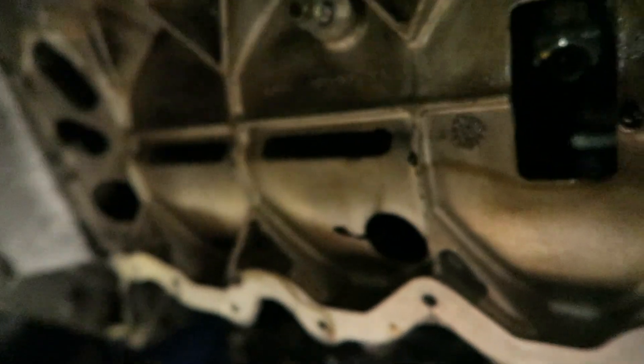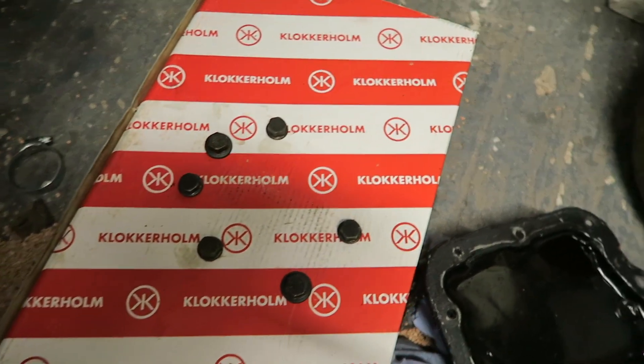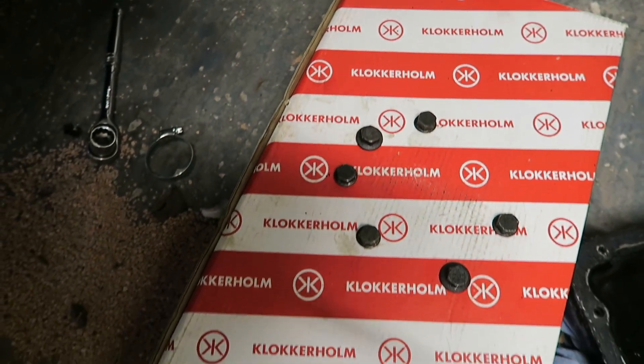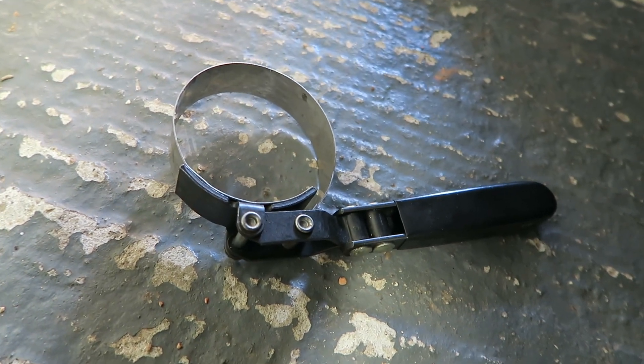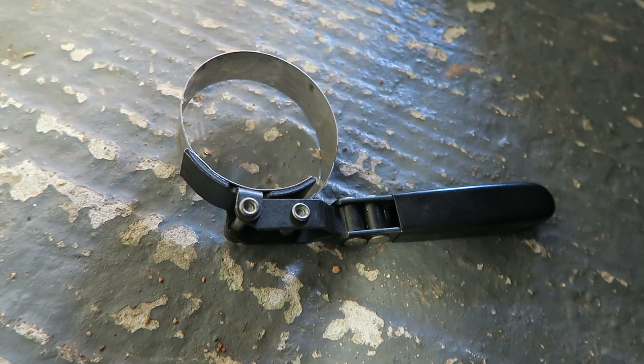The time is 10:09, so I'll come back once I hopefully get this off. Back to report — that only took me about 20 to 30 minutes to get those bolts out. There are eight bolts that go into the lower sump pointing upwards, and then ones that attach to the gearbox. I've organised them in a box showing which way they go. I also quickly changed the oil filter, which is really awkward on these cars — it's all the way at the back of the engine. You definitely need the filter removal tool on this car; on the Fiesta you can just twist it by hand.